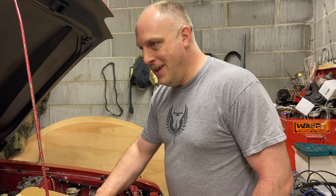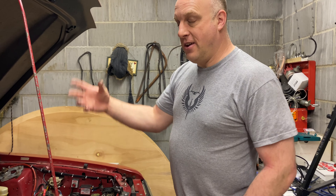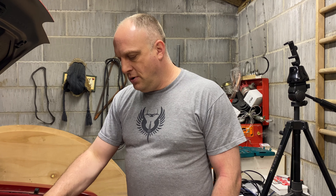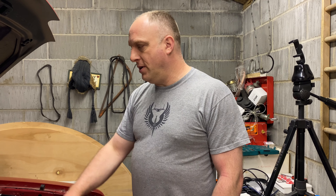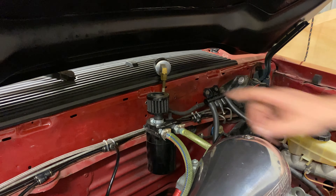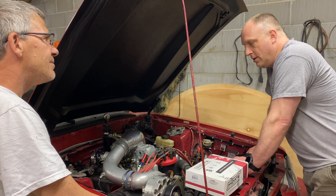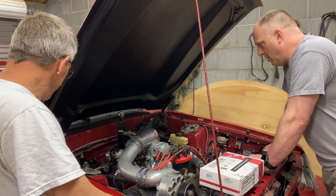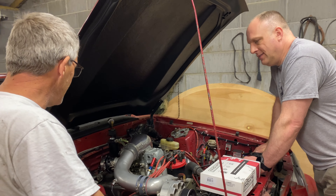But we have to find your A-pillar gauge — I've got an A-pillar now but I can't find it at the moment. I think you've got a triple, because we want to take the boost gauge to put it there, the O2 sensor gauge there, and I'd like to get fuel there too. Fuel pressure right now is here and it's a little hard to see when you're going down the track. We'll have to see what's out there for a remote electric one, because you don't want to run fuel lines into the car — especially at the pillar. That's a fat tube to go up there.